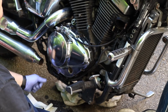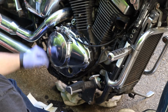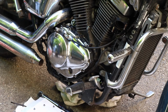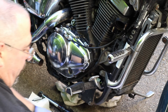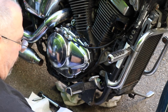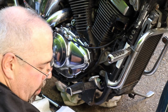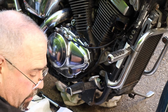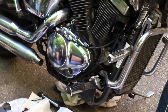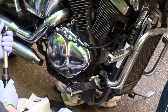Okay, ready to get some bolts on. All right, gang, just about final assembly time here. Two washers that we're going to need. A set of bolts. And I guess it doesn't really matter too much where you start. Correct tightening torque on these is 8 pound-feet. So 8 times 12 is 96 inch-pounds. So we're going to set up our torque wrench for 96 inch-pounds.